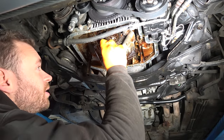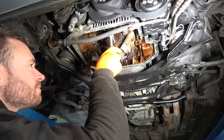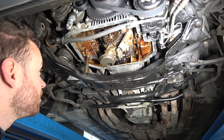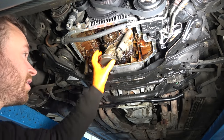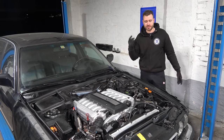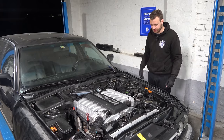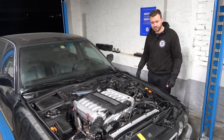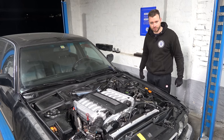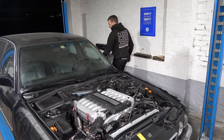Sprocket on, green thread locker over the nut. I'm going to put back the oil pan, replace the oil, and start it again. I should mention I didn't spray brake cleaner directly at the oil pump — rather around it to clean the oil pan, then followed up with fogging oil — but enough brake cleaner got in there and it was sitting for two weeks so it seized. So if you're working on the bottom end of this engine or generally have the oil and oil pan removed, that's something to keep in mind. So let's try this again.